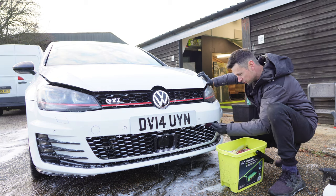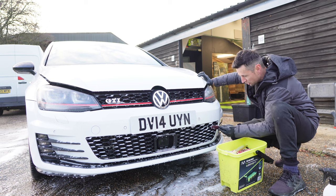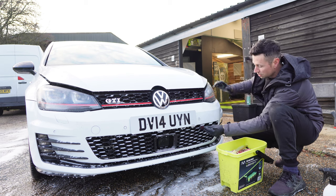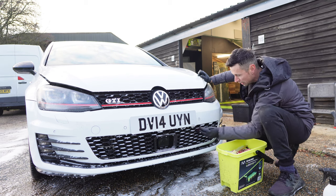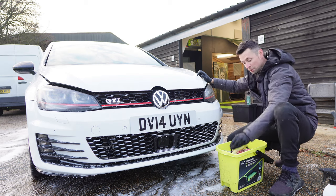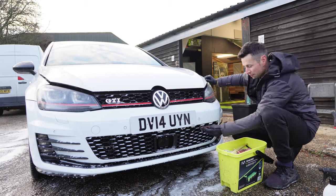For most of you doing this, I would carry this out during the contact wash stage. The reason being is if you really do love your car and you're doing it during the pre-wash — you snow foam it, and although the foam lifts out some of the dirt, if you start swirling it around all you're going to do is cause scratches.